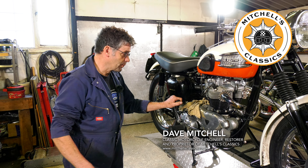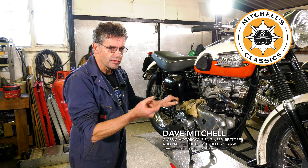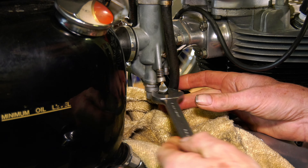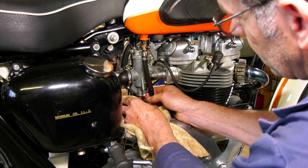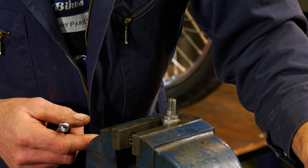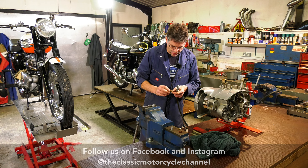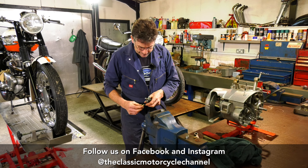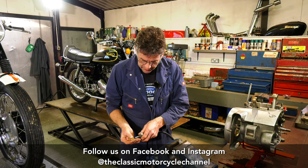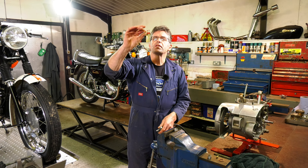What we're going to do now is remove the main jet and the pilot jet. The pilot jet's a little bit awkward — it's right at the front, you'll see in a moment. Now we've removed the main jet, we can just blow this out with an airline. I think it's clear but we'll just give that a blow — it might just have fuel in there. That is nice and clear.